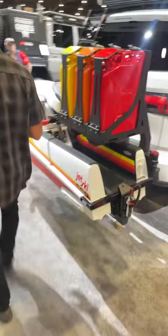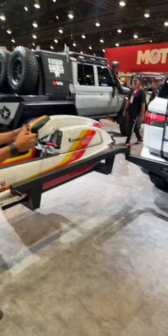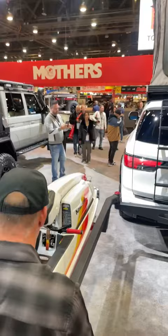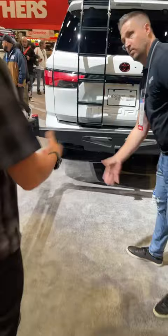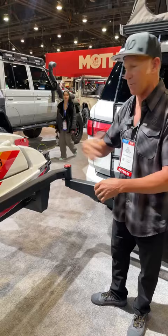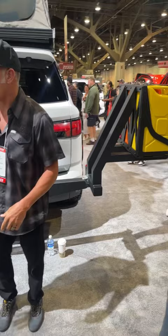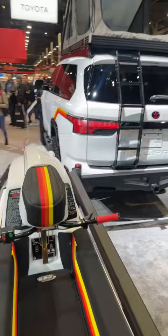The arm is offset here, and that arm is offset so that when you're looking out the mirror backing this up to the water, you can see where you're going. This drops down and pops off, so it literally just backs right into the water and still has tow capability. You can use an extension in here. We did all ball bearings — like wheel bearings — so they're super smooth and handle a whole lot of weight. This thing swings out on the side and locks in. If you stand on the side of the car, you look at the paint scheme with the striping and it literally flows from the car to the jet ski — that's the design behind it.